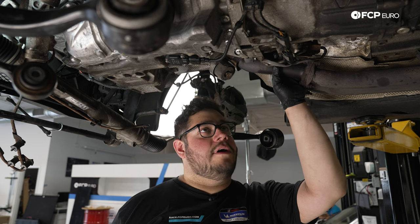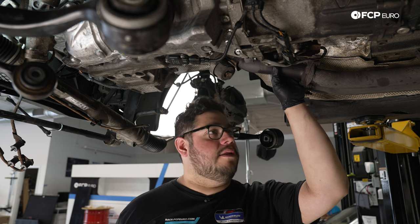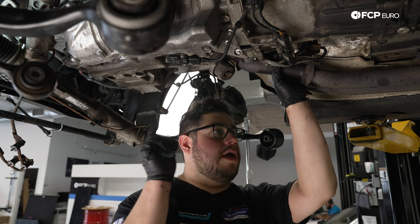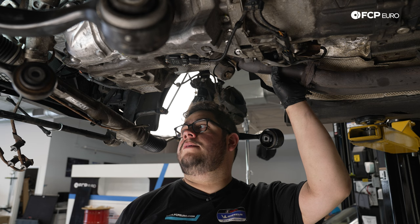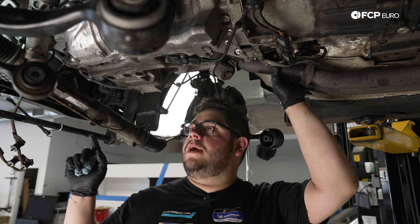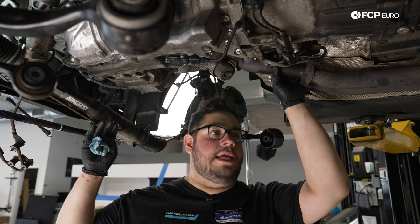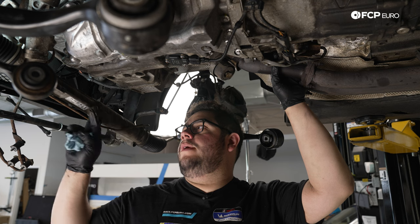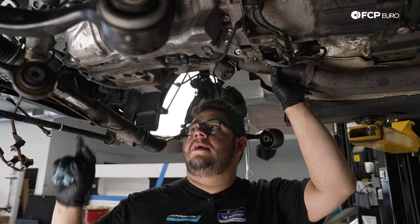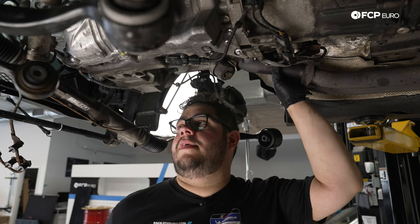All right, now that we have our oil level sensor in, we can work on a couple other things. The next thing could be the front drive shaft going from our transfer case to our differential, so I think we're going to tackle that next. I'm going to wait on the front axles until we have the subframe in place, mainly because I want the steering rack to sit where it's going to be, so I'm not fighting the steering rack and trying to control the hub assembly and all that at once.